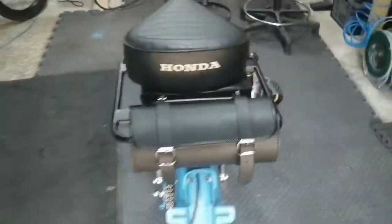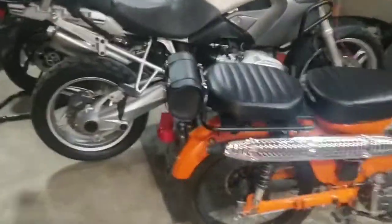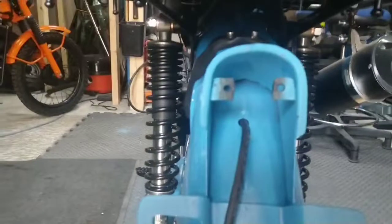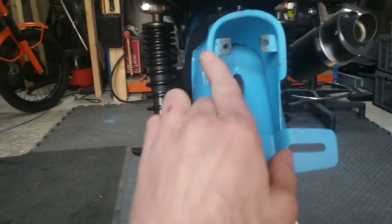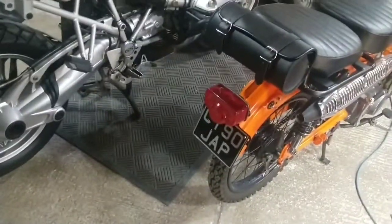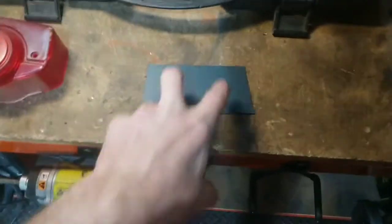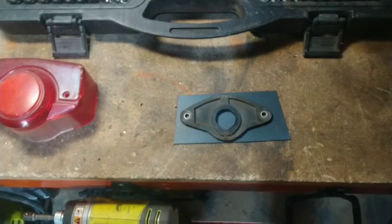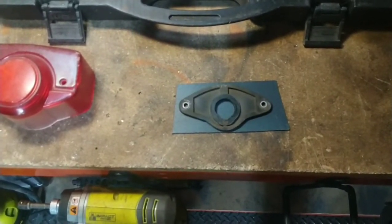The postman's come. I fitted a sort of tool roll on the CT — I think they work quite well. Fitting the back light now; the bracket here was wrong, used to be straight across — I've cut it down. This is the old light unit, same as the CT — it's a standard Honda part. So I need to build a bracket; a bit of fabrication to fit that type of light.